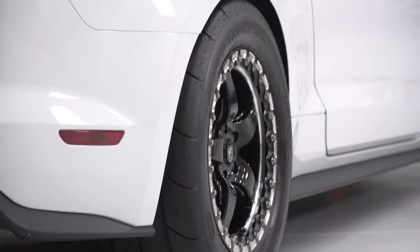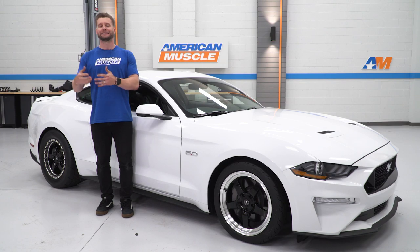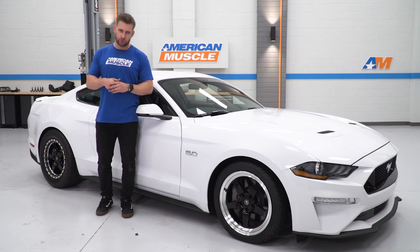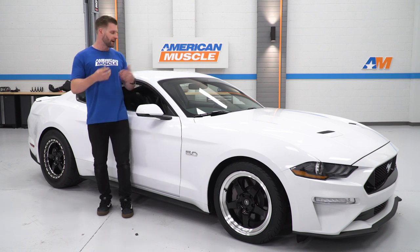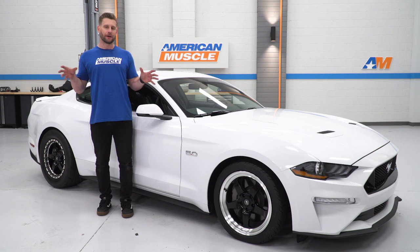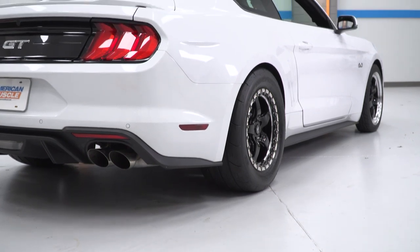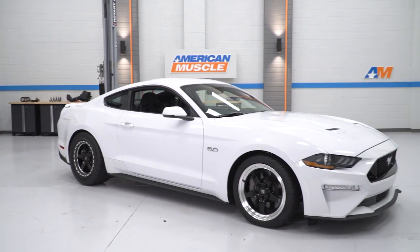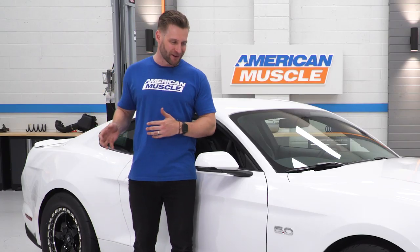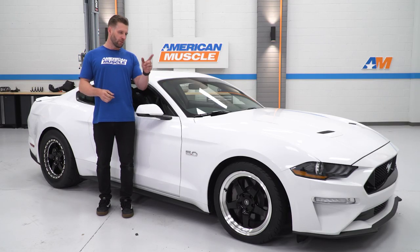It's a 305/45 R17, so that equates to basically a 28-inch tall tire — not really doing me any favors for 10s naturally aspirated; ideally a 26 would be perfect there. But it will be hugely beneficial when we're going for 9s with forced induction down the road, because we want to maximize that 3.55 rear gear the best as possible without physically re-gearing the car. That's my idea behind that 28-inch tall tire in the rear. And plus, she just got a big old booty now — looks killer on the BMR drag springs, just the right amount of rake, really nice stance. But now we're going to do some more appearance stuff, so back onto the lift. I couldn't wait to see how this thing would look on the ground, so throw it up on the lift, do some appearance stuff and one more mod, and then we're done for the day.